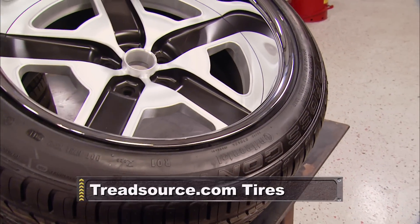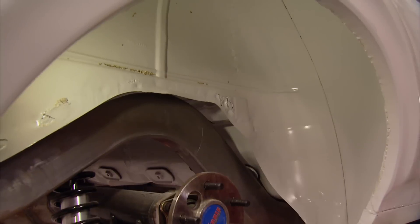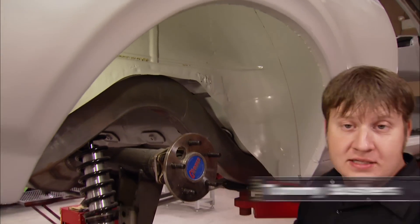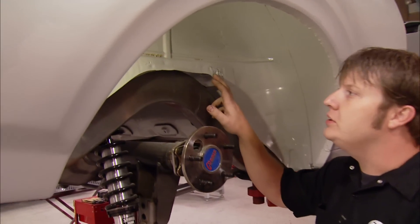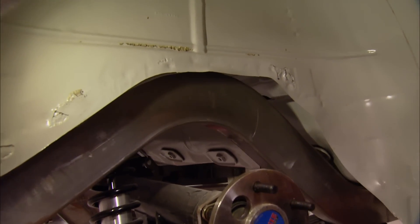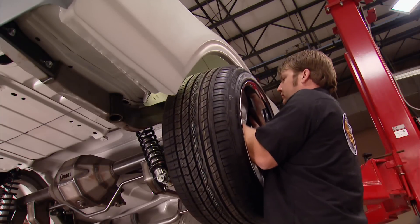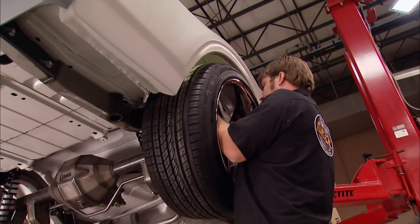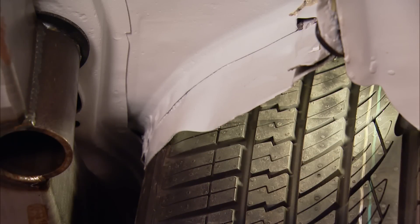The front ones are 19x9 and the rear ones a big 20x12. Now, when running a wheel and tire combo of that size, it's not uncommon to run into some clearance issues. That's the reason why we didn't go ahead and repair the rust in our inner tub — we wanted to have our wheel and tire in hand and give it a test run just to see exactly where we're at. Looks like we've got a clearance issue: the corner of the tire is actually hitting the wheel well and we're not even against the axle flange yet.